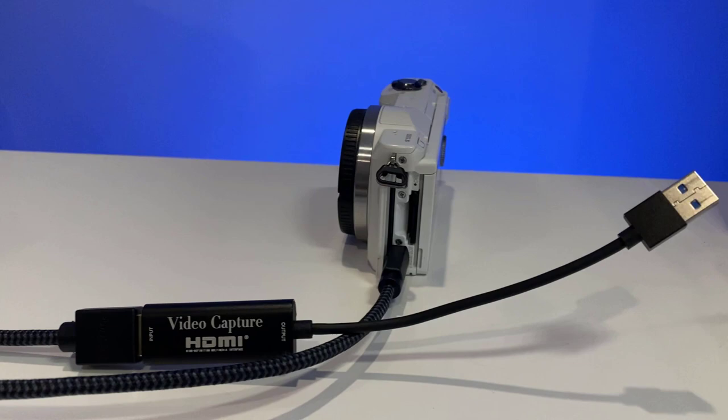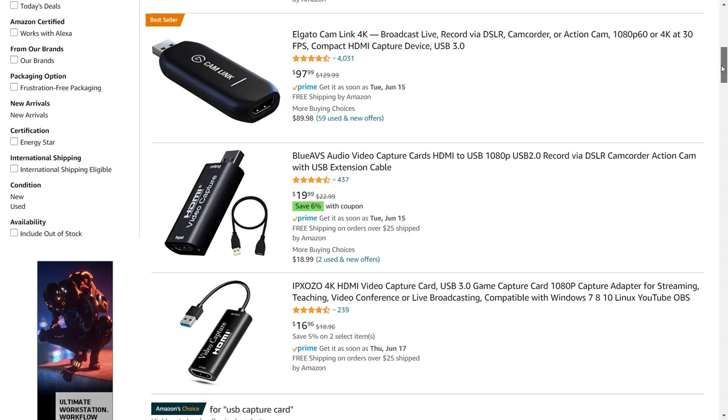Where the real magic happens is converting your camera's HDMI feed into a webcam feed for your PC, Mac, or Linux computer — for that you'll need a capture card. You can go for the $100-plus Elgato Cam Link 4K, which has a bit better sharpness and color reproduction, but I've tested a few cheaper ones. The unbranded ones with the small pigtail USB cable seem to be the best in that price range at about $17 — I've linked to a few I've personally tested in the description. I've had better luck with the ones that have the USB wire compared to the fatter ones without it, having tried around 10 different types in this price range.